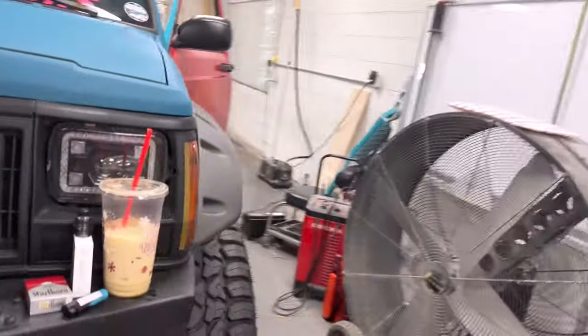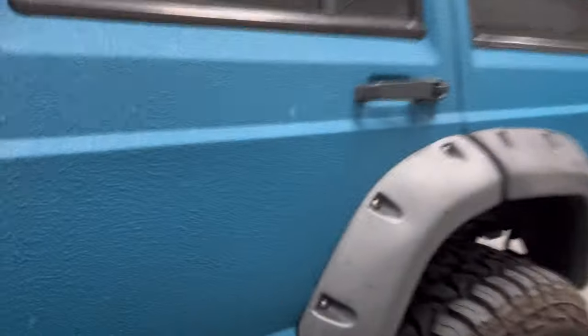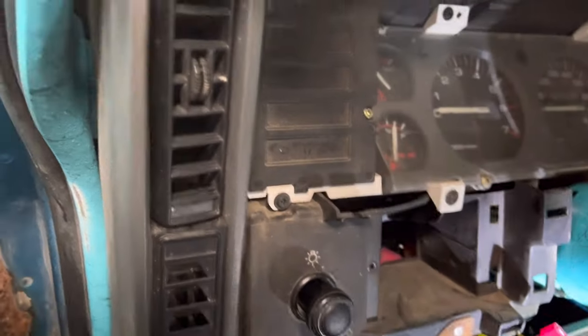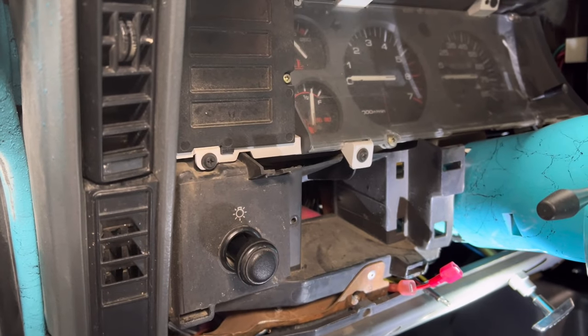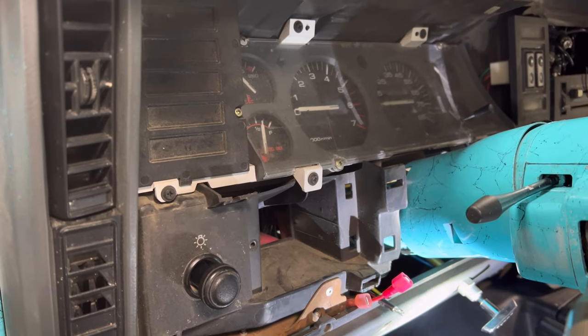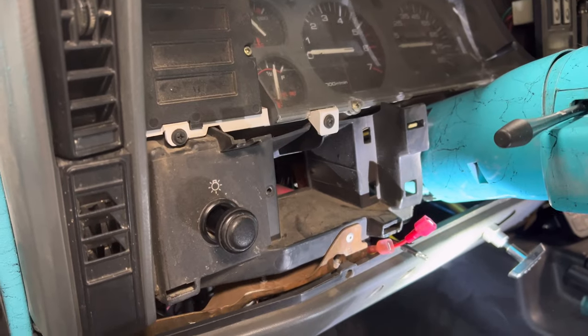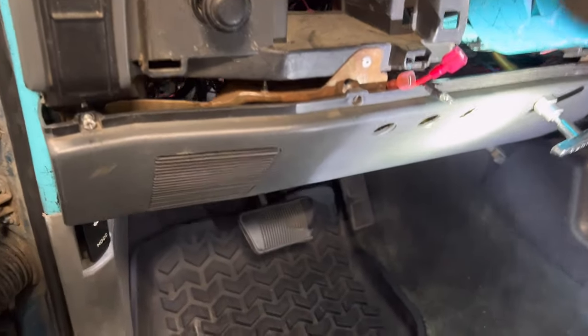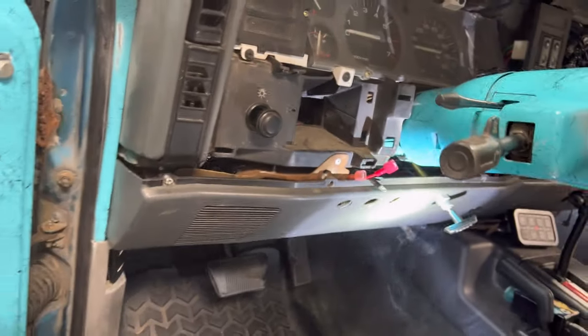I'm at the shop by myself — it's Saturday morning, I left Jangalang here last night. Deb came and rescued me and we took the little Blazer out for a couple hours. Got the dash torn apart — I've gotta get into here and see what's wrong with that switch. I have no high beam indicator, no low beams or high beams. That's telling me maybe the switch ain't getting power, or since it's from 1994, that switch could just have burnt up. Either way I've gotta get it out, which means I've gotta remove this bottom piece. It's got holes anyway — I need to fix it, I need to get a new one.